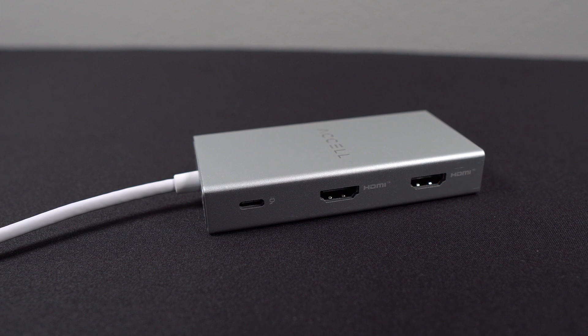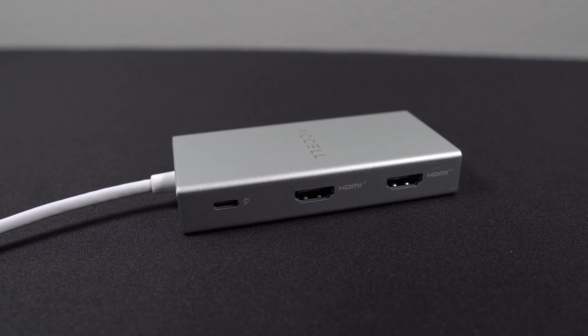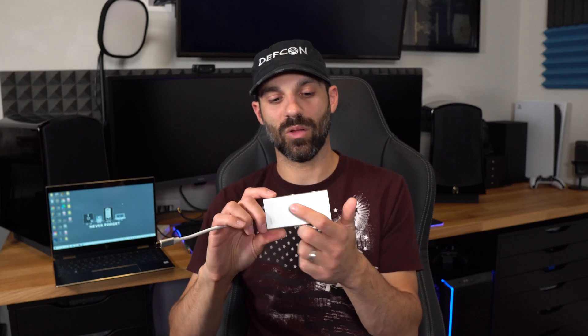At $100, you get two HDMI ports on the back — one is 4K and one is 1080p. That's normal for a USB-based dock that has video output. I haven't really seen any that do dual 4K 60Hz at once because of the limitations you get with the USB bus, and you'd have some serious performance issues at that point. So 4K on this port, 1080p on the middle port, and then you have the USB-C port next to it.